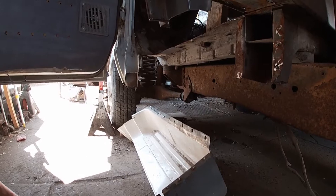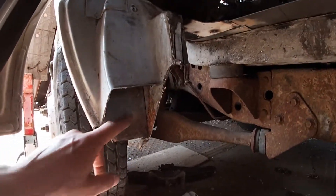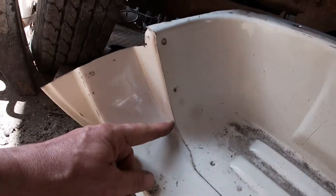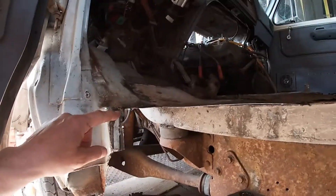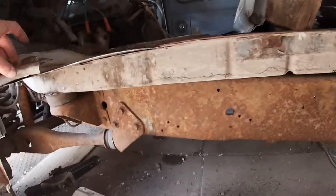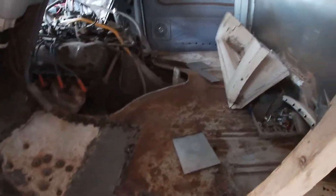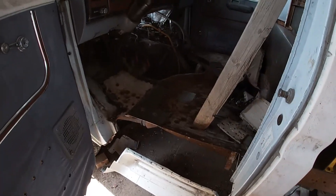Then we'll weld the bottom cap back on at the end and weld it all together once tacked up, making sure our door lines are good. I still have to cut the front to match here — I haven't cut it yet. As you can see the rust kind of ends right here so I'm probably going to follow this line, take this one off, separate the tin back, and cut down here. Hopefully slightly higher and remove this piece of metal here too. This is the corner left in from the original sill footwell — this 20-gauge metal. I'd prefer to do the floor out of 16 or 18 gauge, but thanks for watching.